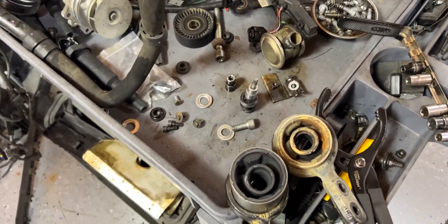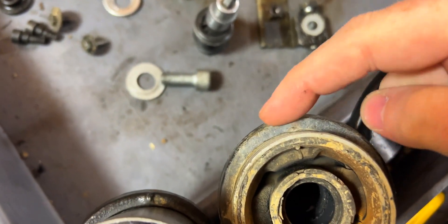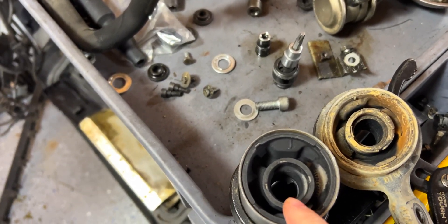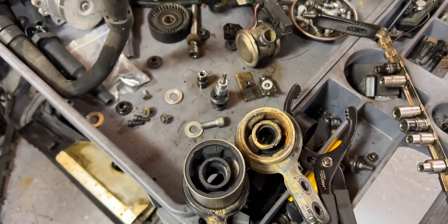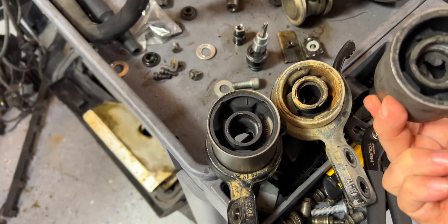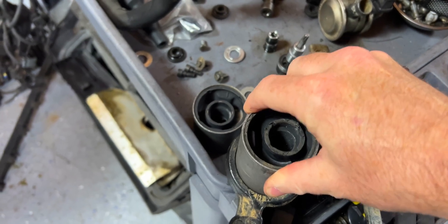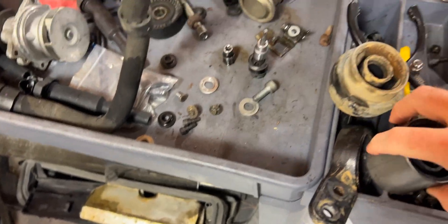So let's go ahead and go over to the press. These are the alignment marks right there — you can see a little nub, it's dirty and hard to see. So we're going to put this one aligned to that. We're back here in the dark corner — open the blind so you can see what's going on. We just set a big socket on top of it, line the marks up. I'll go back here just to the one hand with our Harbor Freight press. We set our blocks up down here just so it barely catches the outer edge of this, and we're going to press her on in, trying to get it through each side about the same amount. If it feels like it stops at any time, that means the bushing is hitting your metal pieces. So we'll fire the press up.